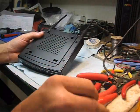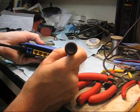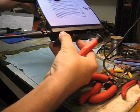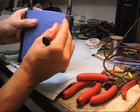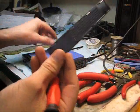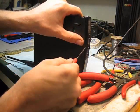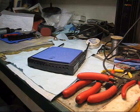Now we've got to take these side panels off — same thing on these, they're just snapped together. I would recommend starting at the back. What you want to do is wedge your screwdriver in there; it's got to be a real fine, small, standard tip. You just kind of walk it down the unit and you'll hear it snap, snap, snap. But do the same thing for the sides — just get in there and walk it all the way down, and it should just pop right out. Same thing on the front of the unit. You probably want to do it where it's not visible in case you do mark it. But it's all snaps — all those pieces are actually snapped in there like that.